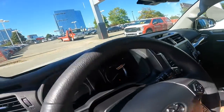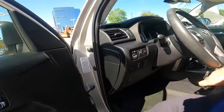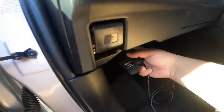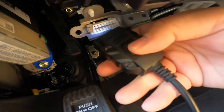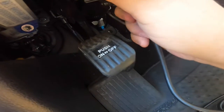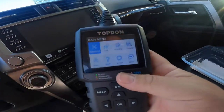What we're going to do is go ahead and hook this thing up. Something that I do like - if you look right here, there's an LED light on the inside. When you're looking for where these things are, you tend to get down here and try to figure it out. I'm in a 4Runner, so it's really not as hard as you'd think. It's usually straight back, which it's right here. I don't know if you can see this little OBD2 connector, but you can look at your angles and see how they fit. Once you do that, you can pop this up here, plug that in, and once that's plugged in, you get your beeps.